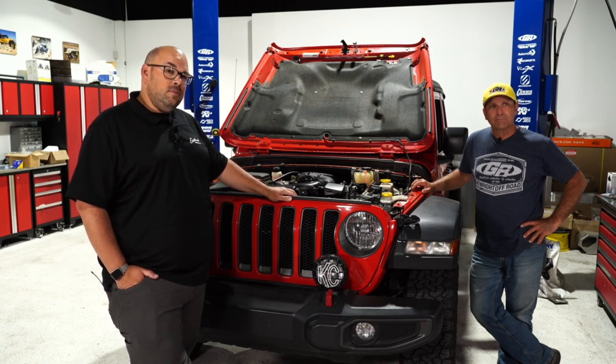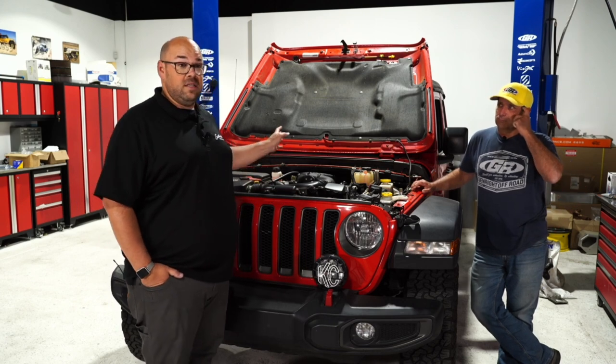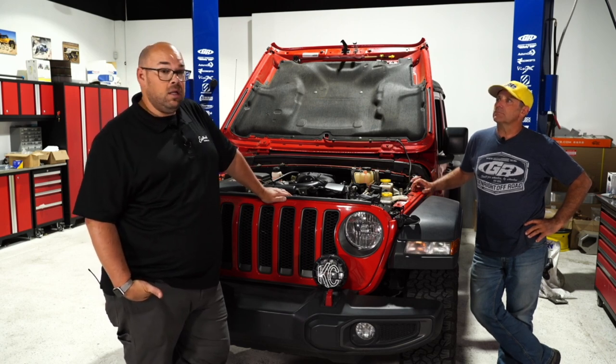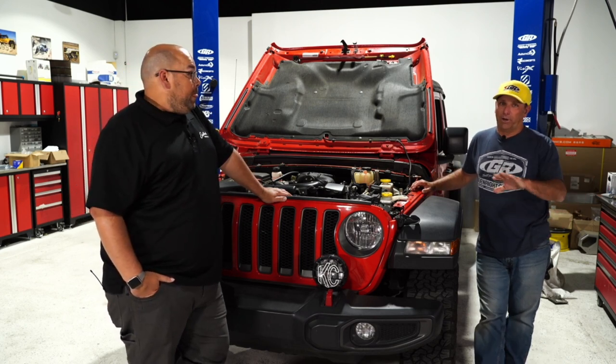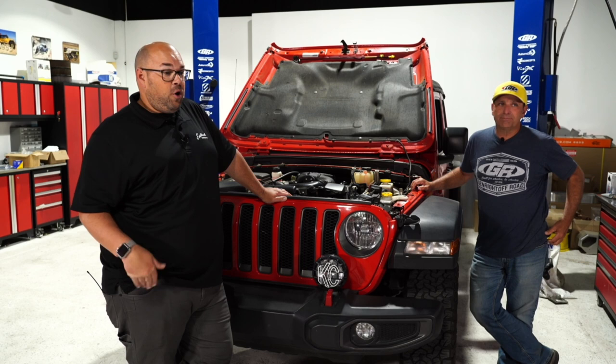A viewer asks: do you need to change the muffler? No — this rig has a stock muffler. You can run a cat-back exhaust and it won't hurt it at all; you won't have to change the tune. Whatever is CARB legal exhaust-wise is fine in California.